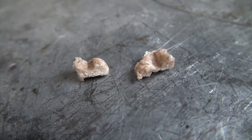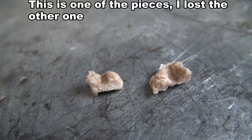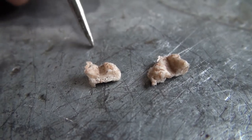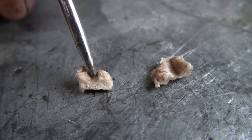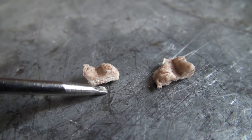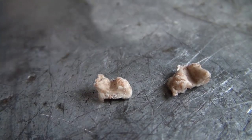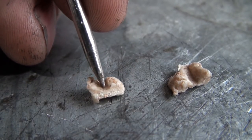I did this procedure about a week ago. I didn't throw out the bread, so it's been in the shop drying out. What I did is I cut it so I could get a cross section to see what was going on. This little groove here is the end of the transfer case. The flat spot here is where that locking device created a flat spot. And that's how close the end of that shaft for the transfer case comes. I measured that to be about a sixteenth of an inch.